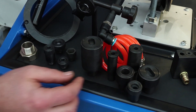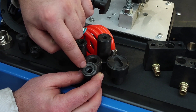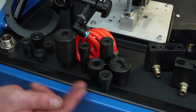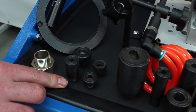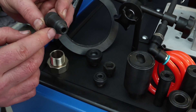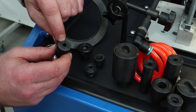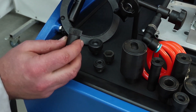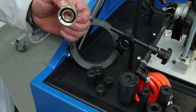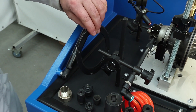The next group of equipment is for draining the oil. The turbo will sit on top, sealing with a rubber ring, and the oil will go through the hole down to the drain. The last group is to feed the oil — it comes with a sealing washer that threads in. On this side we have rubber O-rings so that the oil doesn't leak out, and knurling so that it is easy to tighten the nuts. There is also a coupling nut to connect the machine to the pneumatic system, and two rings to press the halves of the cartridge together.